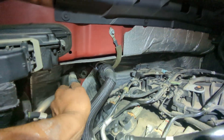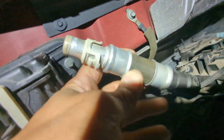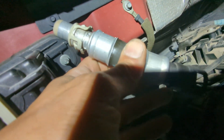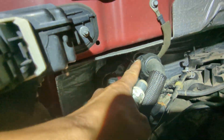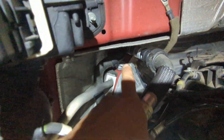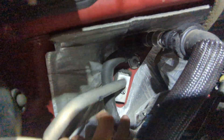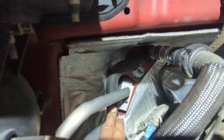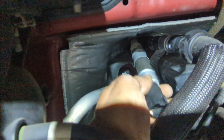I also want to show you a nice little thing — I've seen some of them from the factory look like this without the jumper. I call this part a hose jumper; the part number is KH559, which I think is a Motorcraft part. This one here — this hose is not long enough to eliminate the jumper, but on this one it almost looks like it's supposed to be that way. There were two jumpers on here and they were both leaking.